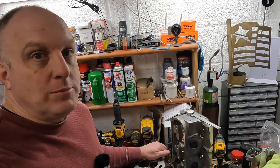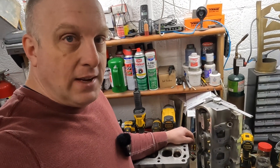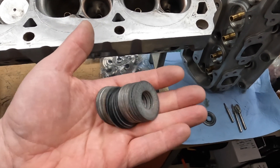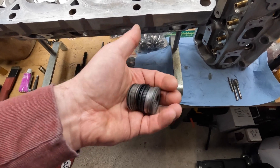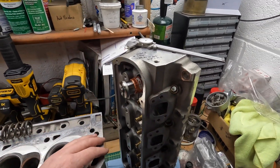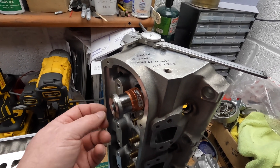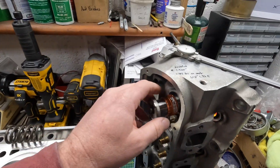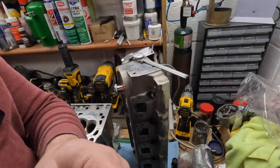Back in the day there wasn't a whole lot of heavy-duty or hydraulic roller cam springs available given how old these heads are. What somebody did — based on the amount of shims that came off this head — is each valve has 0.070 inches of shim stacked under it. Nominally you should have about a 2-inch installed height with a solid roller spring; for a hydraulic roller you're about 1.8 inches. With the shims, the spring cup, and these nice titanium retainers with 10-degree keepers, all of these valves are sitting at 1.9 inches installed height.